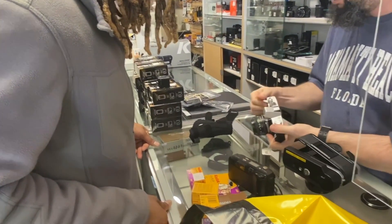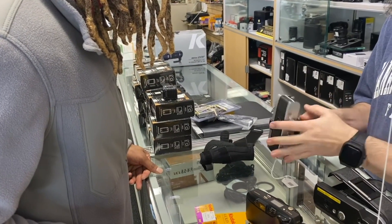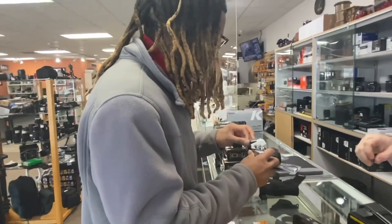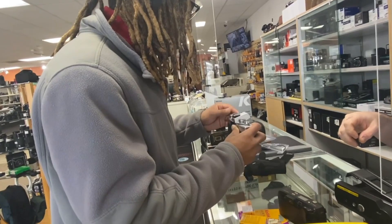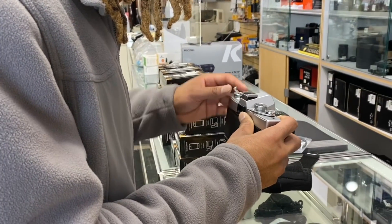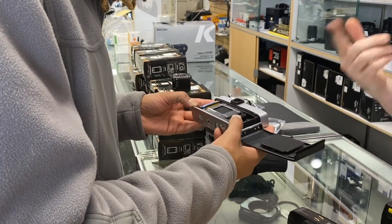So then you would go until you're at one — shoot, shoot, shoot — and then you want to rewind it, push that in. You'll feel that there's gonna be tension right at the beginning. You'll go around two or three more times and you should be good. Go ahead and lift that lever up, pop that back door open, pull it and it will pop.